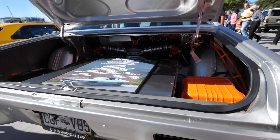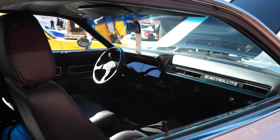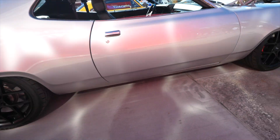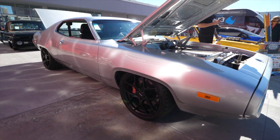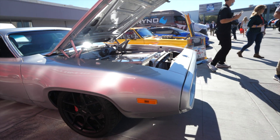Do you know how much life that battery had? Because you got it out of a car, right? I got it out of three cars. It ranges — one of them had 40 miles on it, two of the modules, and the rest are about 9,000 to 12,000 miles. So they're fairly fresh modules. Yeah, you mix and match modules — 16 total. I always wonder how that works because the thing to do is to try to get them from the same car. What happened is they got damaged in shipping — they left the coolant in it, some got corroded, one got cracked in half. So I just kept piecing them together.